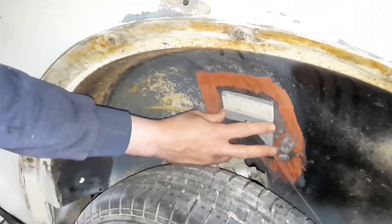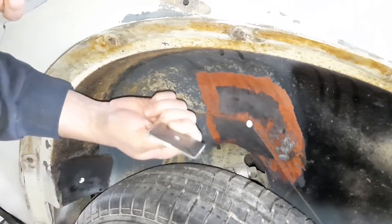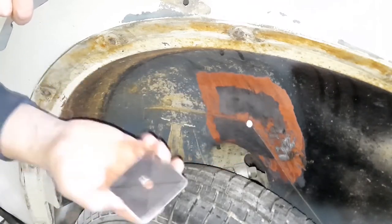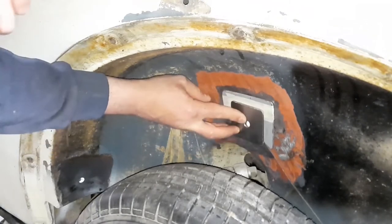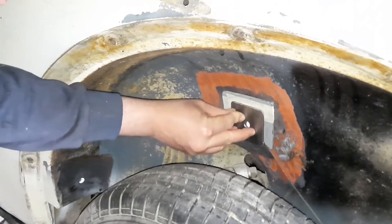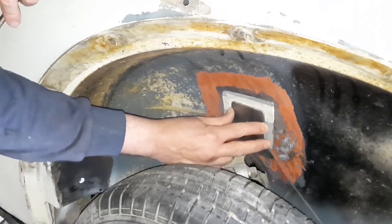Because you've got two options. You either make up some spreader plates, or you would have to try and form, do a pressing on the 3mm plate to allow for the step so that it would sit flush, because the plate has to sit flush. So in this instance, you also want the shim or the additional spreader plate to be larger than the actual plate, because you've got to remember that you're spreading the load, and also everything has to be able to deform.